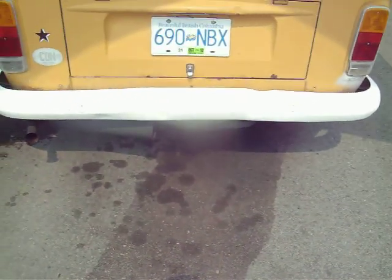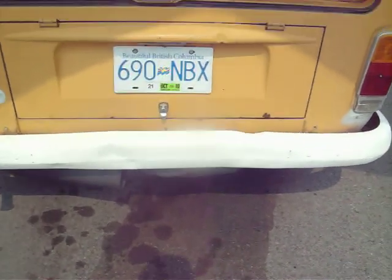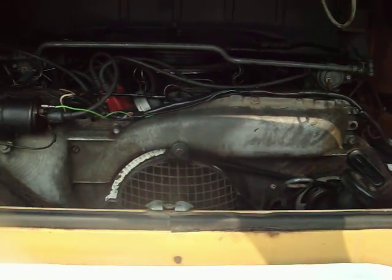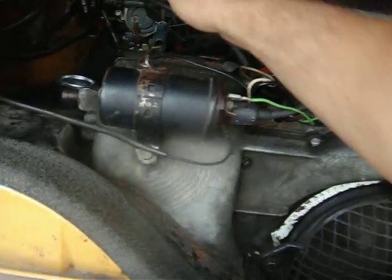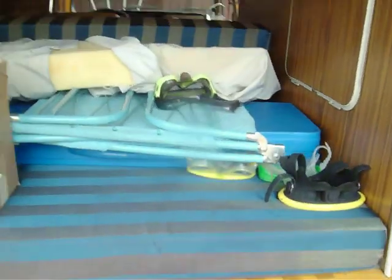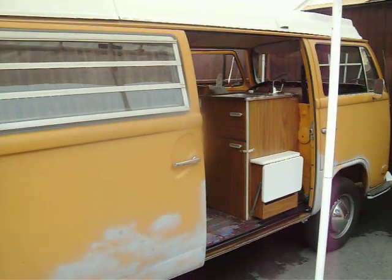Off the cover here. I actually painted the bumpers — they're kind of a little bit dented and stuff, but that's okay. Looks better anyway compared to the rest. The motor seems to run pretty good. I had to reset the timing — the number one and two plug wires were backwards, and someone had tried to set the timing that way. But it seems to run pretty good now. You can see a little bit of popping here and there. Okay, that's it. Enjoy. Later, Gator.